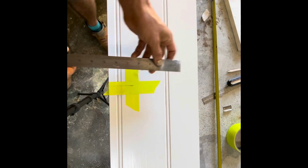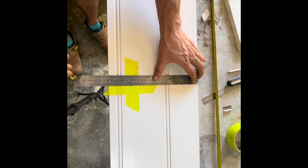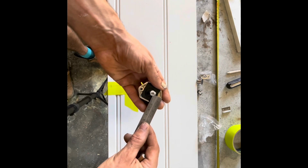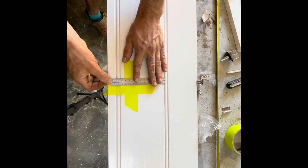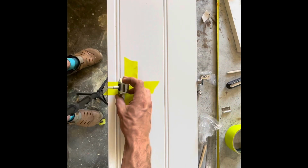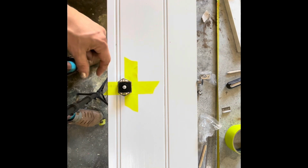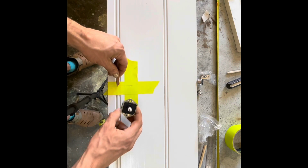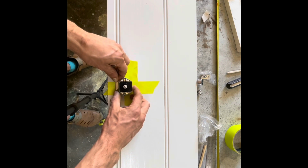Alright. Now we measured inside and it was 25. The center of that pin is 1.5, 1.6. So we go from that point to 1.6. This is going to fit with there, on the reverse side of the door obviously, and then behind it, you can see that's our latch. And inside the bus, this will screw on to that rail, like that, and you will go in like that.